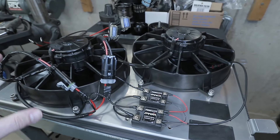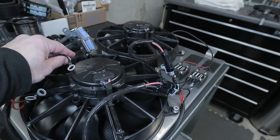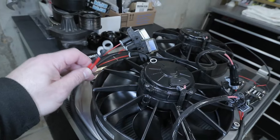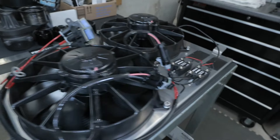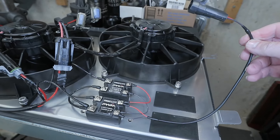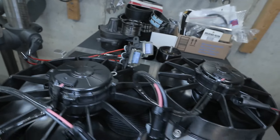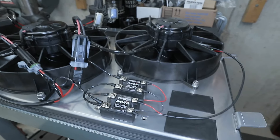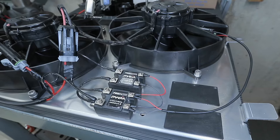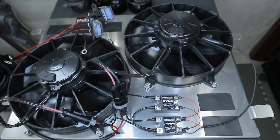Welcome to the channel. Today's video is going to cover a quick summary and review on the ProSpeed fan dual fan setup for the ZR1 C6. This is an awesome fan setup — a complete upgrade to the OEM fan, which is one big single fan. This here is constructed of an aluminum chassis or shroud which fully captures the fins in the radiator to provide enough suction through the whole core of the radiator. The factory piece has spots where it's wide open and isn't able to draw on the fins the same way. As you can see, these are two high-quality 12-inch Spal fans — high performance and heavy duty.